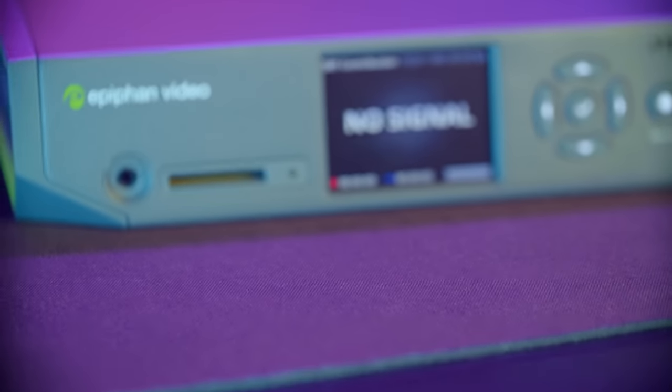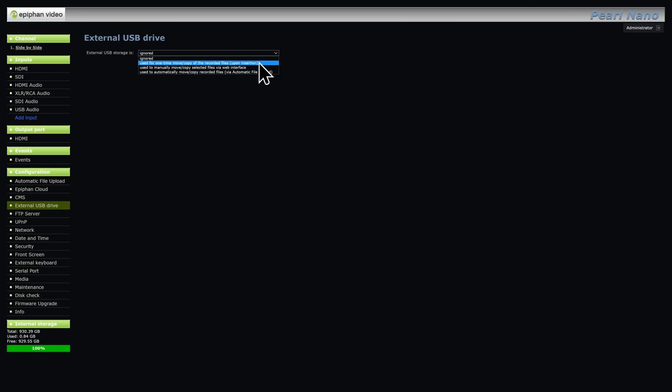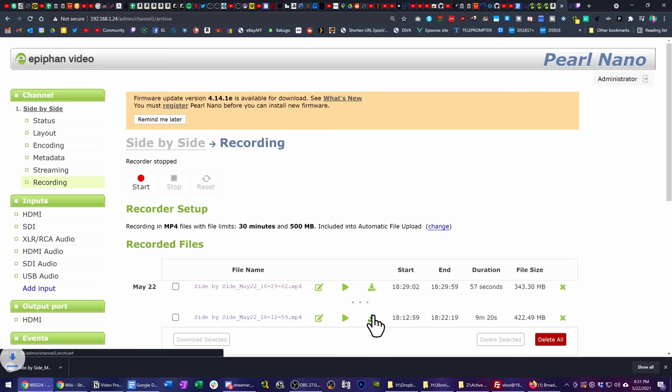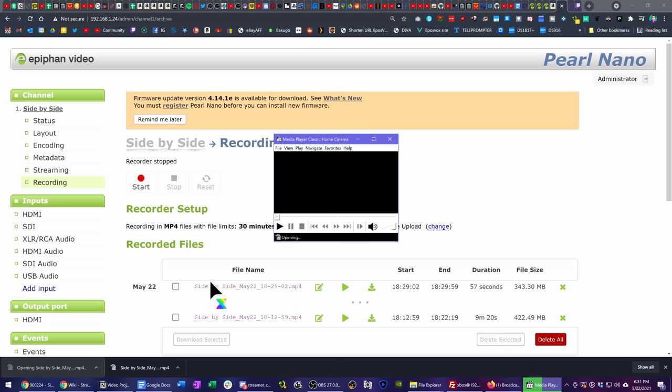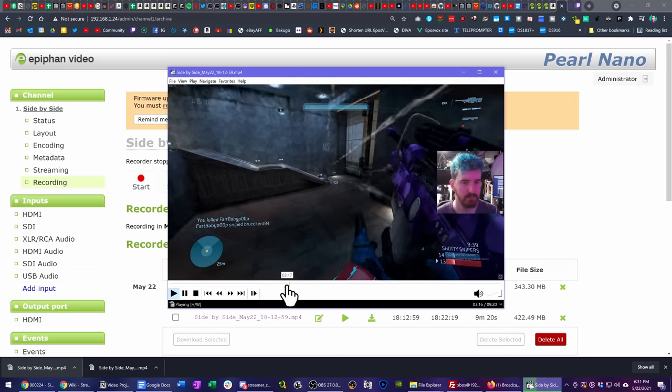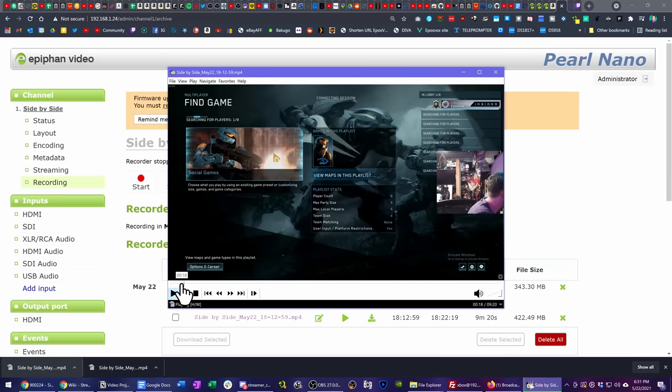Recordings can be managed quite competently. You either record directly to the SD card or the SSD, but not both. From there, you can configure automatic file uploads to network storage locations, Epiphan Cloud, or direct uploading to Kaltura or Panopto. You can copy files to a USB drive, access the Nano via FTP, or directly download files through your web browser from the management interface. The streams and recordings are saved in the same quality, so you cannot run a high-bitrate local recording with a low-bitrate web stream, but you can pass either of the HDMI outputs to a dedicated video recorder.